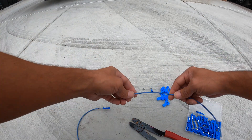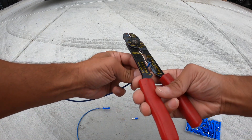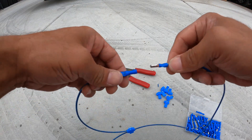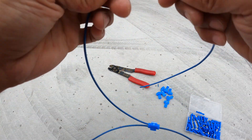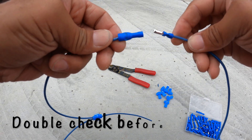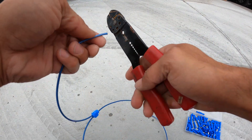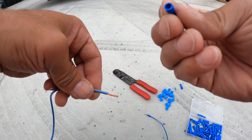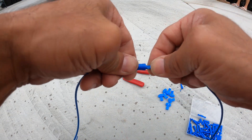That's not going anywhere. This would be our LED light side - strip the wire and take the other piece of the bullet connector for a secure connection. Actually, I crimped the wrong side - that's not going to work. Good thing this was just practice. I put it into the bullet side; it should have gone into the smaller side right here. Now that's a nice tight connection and we can click in our LED lights.